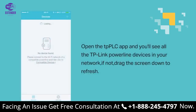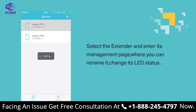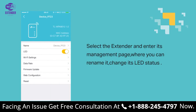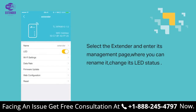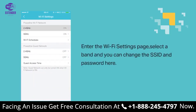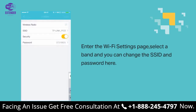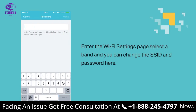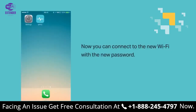Open the TPPLC app, and you'll see all the TP-Link Powerline devices in your network — but if not, drag the screen down to refresh. Select the extender and enter the management page where you can rename it and change its LED status. Enter the Wi-Fi settings page, select a band, and change the SSID and password. Click Save or Done and continue, and you'll be disconnected from the extender. Connect to the new Wi-Fi network with the password you have just set.